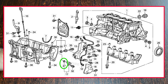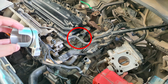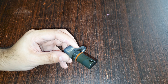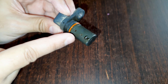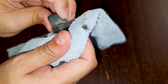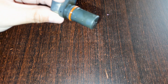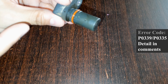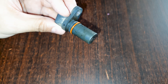If you've seen any of my previous videos, you would know that I changed seals on the same side of the engine — the camshaft seal, the camshaft sensor O-ring, and the VTEC gasket — with new seals that would put pressure on older seals and cause them to leak. There's a magnet over here, and you can see it has caught some debris, so I'll just wipe that off. Overall, I have no issues with this sensor. If you are having issues or have an error code, you could clean this up with brake cleaner or throttle body cleaner. You may have sludge buildup, so timely oil changes are important.